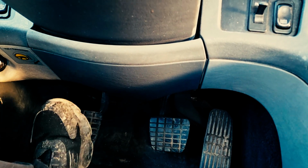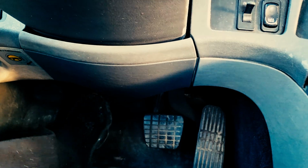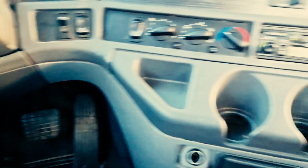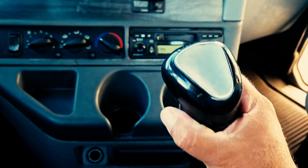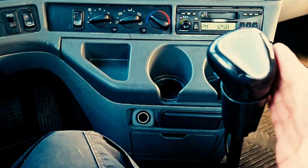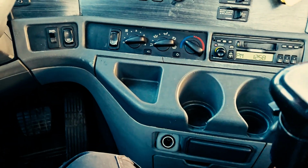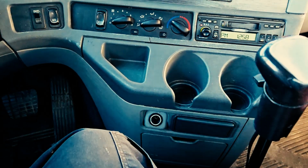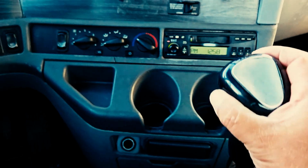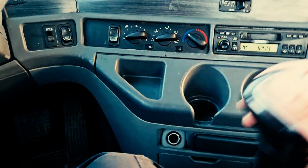Okay, but for a safe start, we're parked, we're not driving, so we can engage our clutch brake to ensure that there's extra safety. We're going to make sure that our gear shift is in the neutral position. And how can we do that? You can tap it to the side right here. On the left side, you have a spring wall, which will bounce back. On this side, to the right, just a solid wall. There's no spring, so there's no bounce. This side, you can feel it.